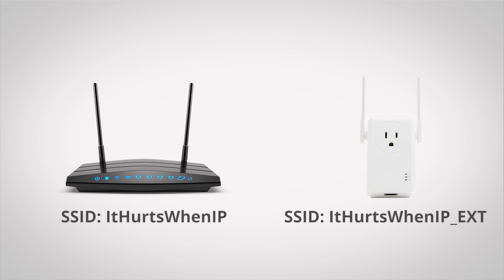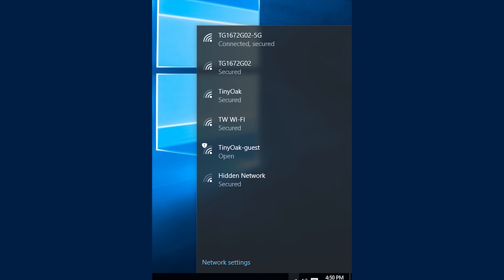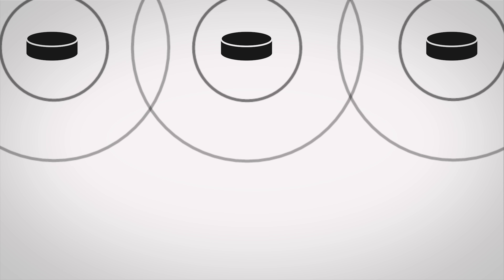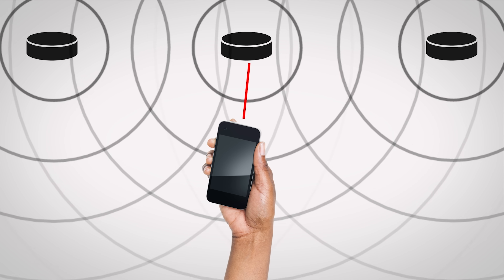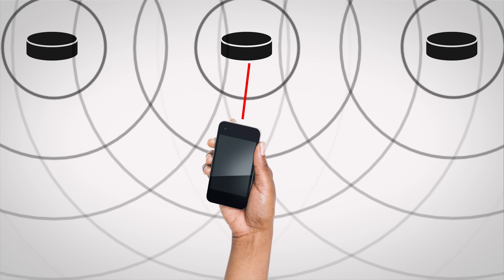As it turns out, yes there are! What an extender does is create a whole new Wi-Fi network instead of being a true extension of the one created by your router. This puts you into one of two less than ideal situations: one, if your extender uses a different network name, or SSID, you have to manually switch to it when you want to use it. Or two, if your extender shares the SSID with your main network, most devices aren't smart enough to automatically switch to whichever one is giving off the stronger signal, leading to frustration when you walk between your router and the extender. Mesh Wi-Fi, on the other hand, uses one single network that's intelligently managed by whichever node serves as your primary router, making it a seamless experience as you move around your house.